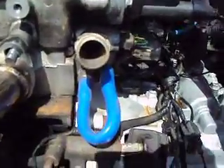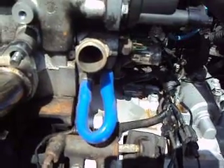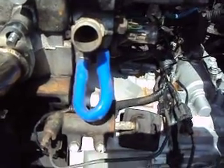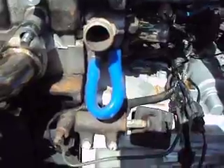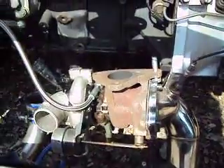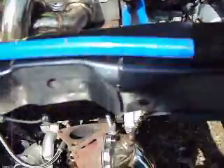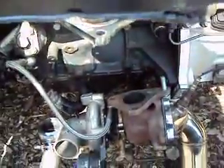On mine you'll notice I haven't added the water cooling lines, purely because it's a track car. I've read that they can cook your radiator system because the turbo gets so hot, and the radiator on this car is so small that the heat from the turbo can just boil your coolant system. Last year mine did overheat and spun a bearing, so I'm not going to use the cooling lines this time — it's just going to be cooled by the oil.